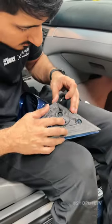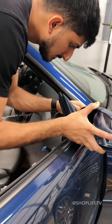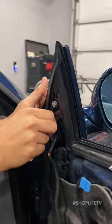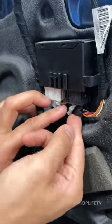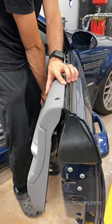With the screws tightened up, let's put everything back together. Route the wire back into the hole and secure the rubber wire grommet. Put the two screws in carefully so you don't strip the holes. Fasten the cover and don't forget to plug it in. Replace any broken clips on the door panel before reinstalling it, and be sure to line up all the plastic clips with their holes before you start whacking it in.